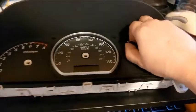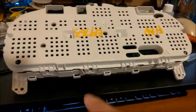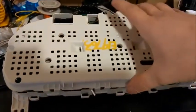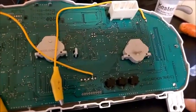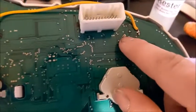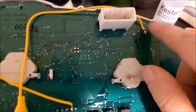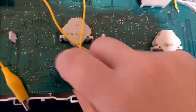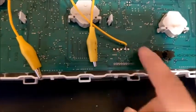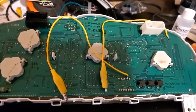Then pull off the back — get all the way down to the board. Next you want to get off the back cover, taking off all the little clips. To make this easier, instead of running out to the car a hundred times to check the odometer, there are pads up here for ground, ignition positive, or battery positive. I couldn't get the solder to stick to the ground pad, so I used another ground point. I put a lead to battery positive here and a ground lead — just regular leads — and hook this up to a 9-volt battery to power up the display.